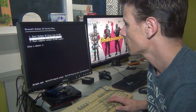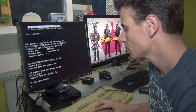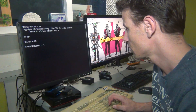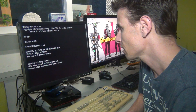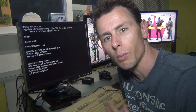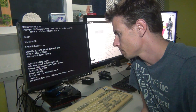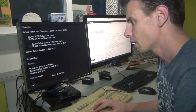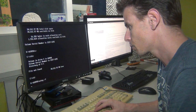We're gonna start the computer with CD-ROM support, because now we've created the partition, now we're gonna format it. Format C. The quick format won't work because it's not already formatted — this will take a while. Alright, the formatting is done. It's writing the FAT table, and now we can give it a label which will be Win98. A fresh and clean drive. Let's start the Windows 98 setup.